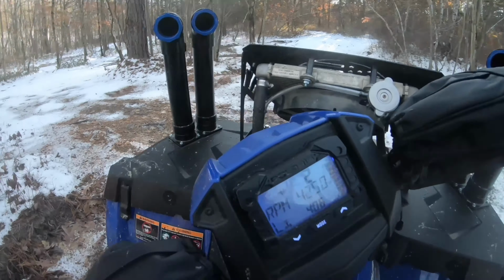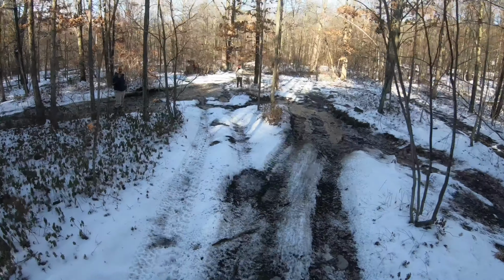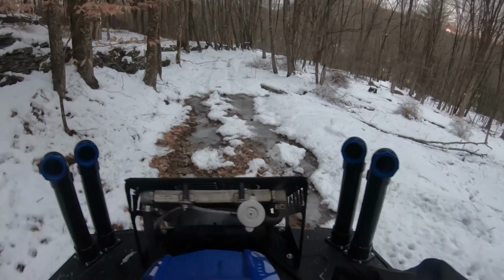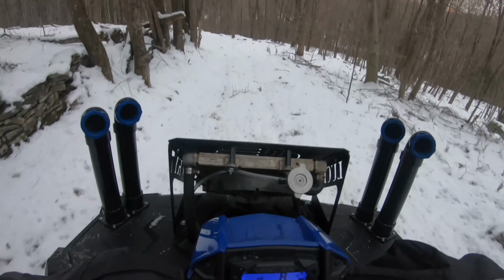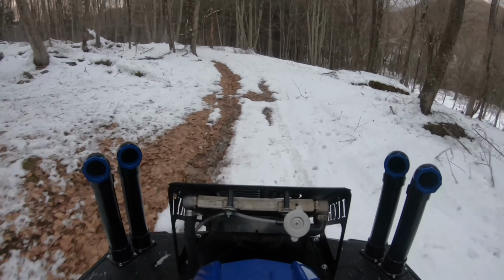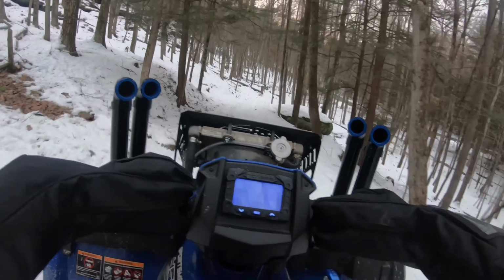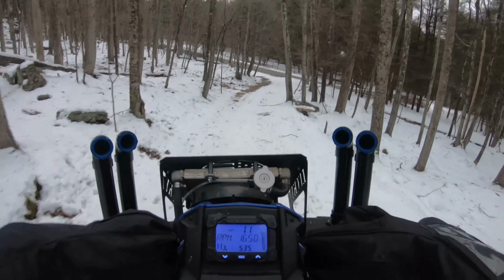Ooh. All I can say is it goes through spinning the tires a lot quicker. One of the things this kit actually fixed too is when you're coming down a hill and you're on the throttle a little bit and you let up and then you get back on the throttle again. When it was stock, I noticed it mostly when you do that, it would almost lag and kind of slow you down and kind of jerk you forward. Yeah, it doesn't do that anymore. That's quite nice, actually, I gotta say. On top of all the other benefits, I got nothing bad to say about this clutch kit so far. I know we're still in the early stages of it, but so far all positives.